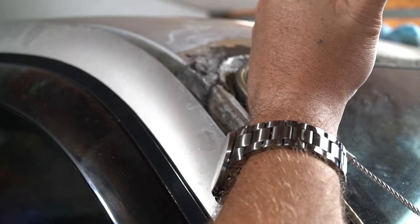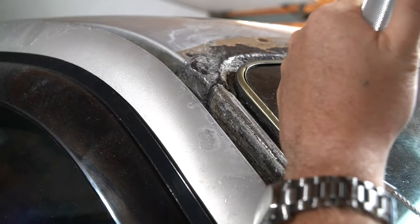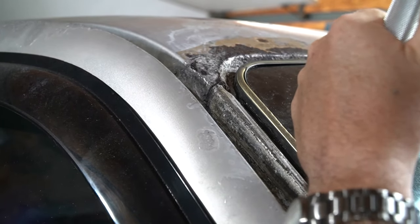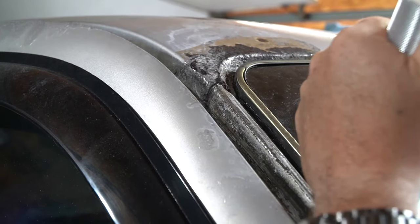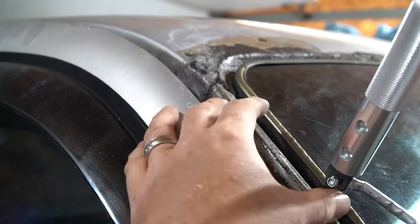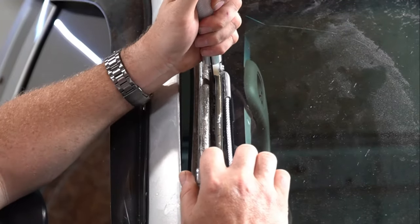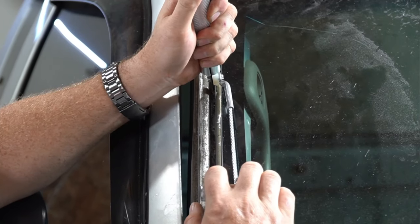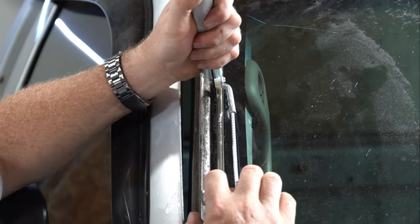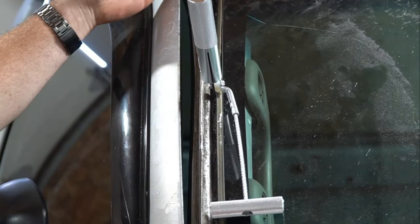You're probably going to break or chip the windshield at some point — with experience you might avoid it, but I've never had that luck. As you can see, we're slowly cutting this gasket out. I'm giving it a lot of effort — really pulling hard — and it's taking a lot of muscle, but we've cut a couple of inches already. If it starts to stiffen up and the cut gets hard, just heat it up a little more with the heat gun and keep working it. A little heat goes a long way, and you just keep working yourself down the edge of the windshield until you have the whole section cut.